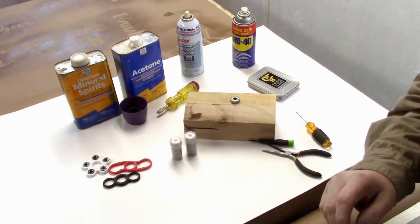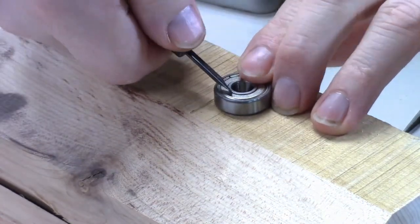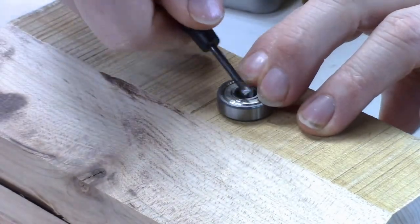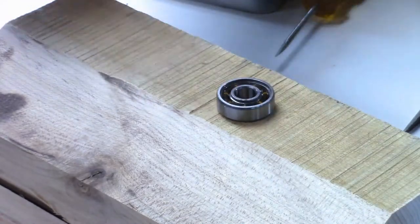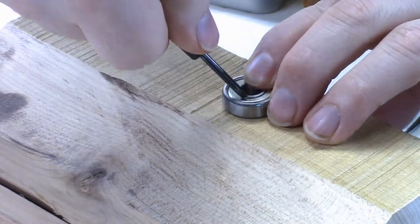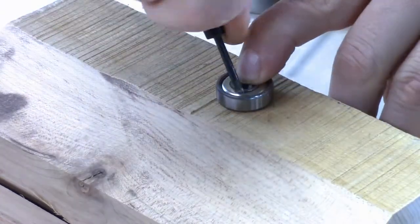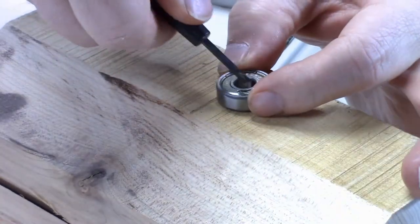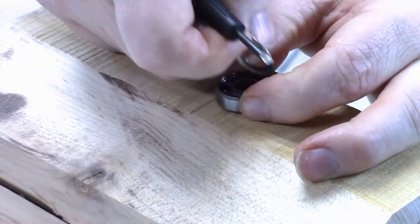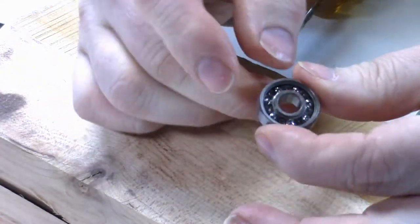So what you're going to do is once you get a shield, push down on it first to kind of make a void there, because they're not easily popped out. Then try to get your screwdriver underneath the crack in that void and it should pop up. One side will have grease on it and the other side may have a little bushing of sorts. Just push down on it, get a little twist action and it should pop it right out. Sometimes you struggle with them — it just takes a little bit of practice. And there we go, first one is done.